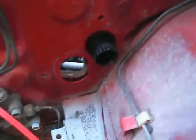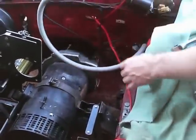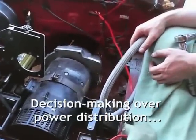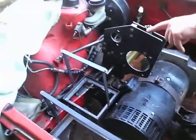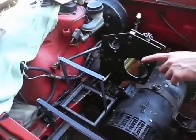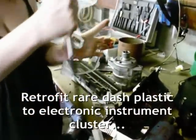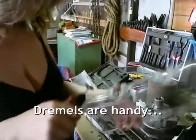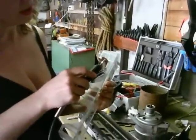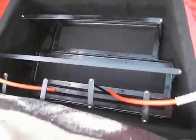Here she comes. The batteries — which might even pop up here, or might even go underneath and pop onto the first battery over here — and then we'll go around. The negative cable will probably go to the batteries, so it's going to be negative battery all the way around the positive battery. Positive battery goes to the main contactor. From main contactor goes to shunt, from shunt to — the controller. And I'll just use the edges to smooth it off. That's going to be pinned up in a minute.